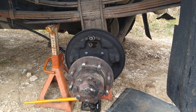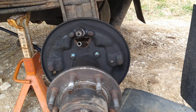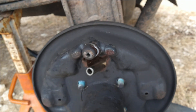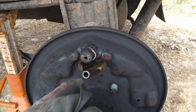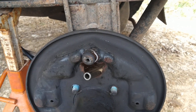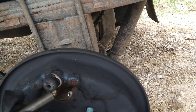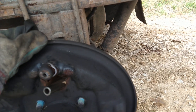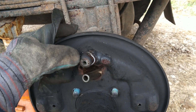If you can't dodge it, ram it — that's what they say. Well, apparently Chrysler Mopar should have actually built these Dodges to handle something. Here's the current condition of this driver's side backing plate on this dually. I knocked on the whole assembly with a chisel against the head of the bolt, then took a brass punch behind and in between, knocked it some more. I got this steel bushing here just to cover that brake line, because I'm going to have to clean this up enough it won't catch on fire, and put the grounding clamp here and weld it in place after I get that straighter.